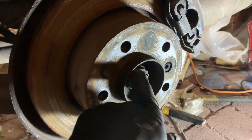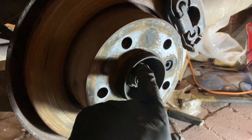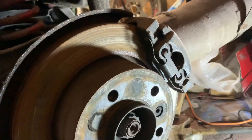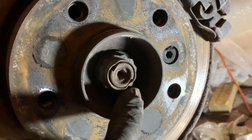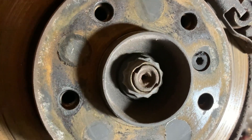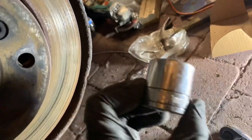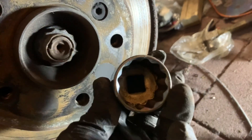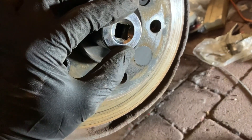Let's start off very simply - just need to take this hub nut off. We'll do that first, then take the brake caliper and carrier off, then the disc. These are usually dented in to stop them spinning around, so you just need to get a flathead screwdriver and bang those out. Once you've moved those out of the way, you want a 30mm socket on there. I like to use the one that matches the splines - 16 or something - rather than the usual eight.